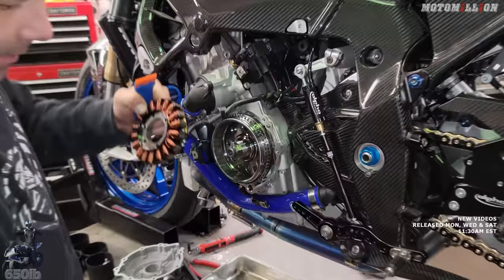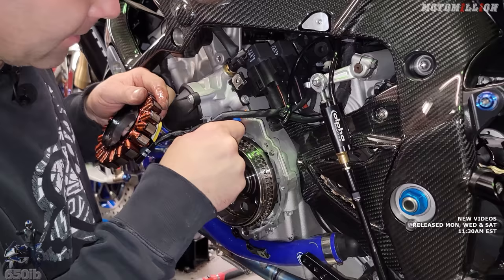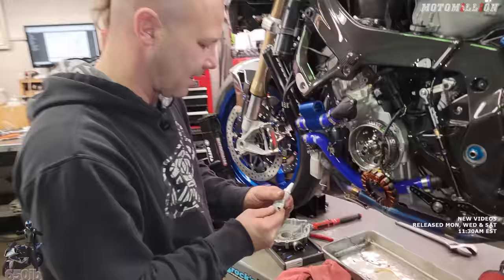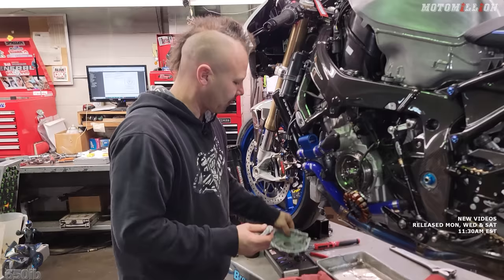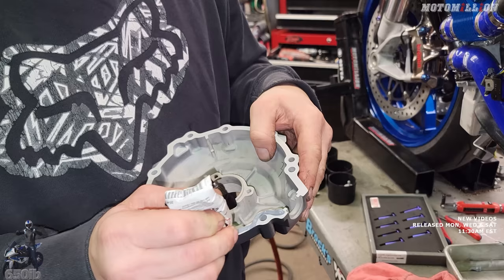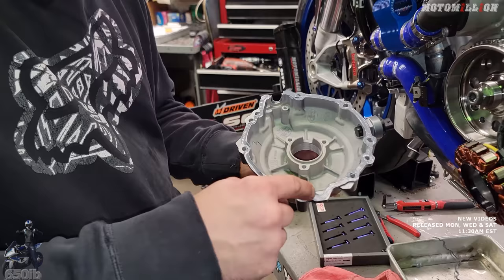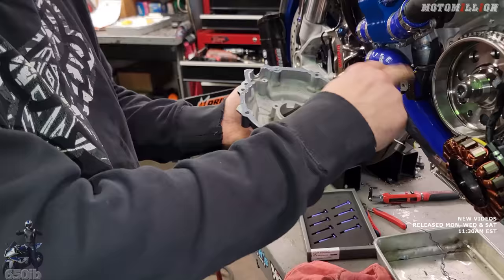Anything that's stubborn, we can use a little plastic scraper because the plastic won't damage the aluminum. This is the sealant BMW recommends — it's Dow Corning. I've used Honda Bond before and it's fine. If you like Yamabond, you could use Yamabond, Suzuki Bond, whatever bond you like. I've never had great luck using just straight silicone like you would on an old car — the manufacturer's bonds do seem to work better. I like to smear it instead of leaving it in a big bead; I feel like this helps it seal better and I get both sides of the hole. Nine Newton meters is what it calls for.